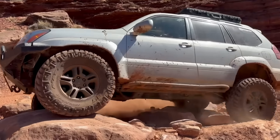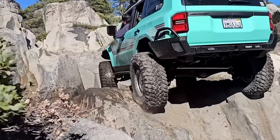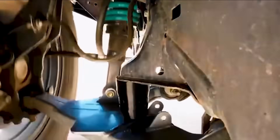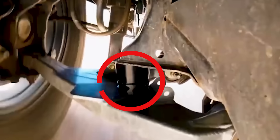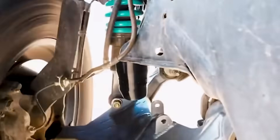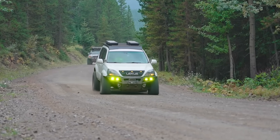What the heck is a bump stop? If you are an off-roader, you are driving your vehicle through very harsh terrain where the suspension is pushed right to its limit. When the suspension is fully compressed, it hits the end — the spring is fully compressed and now you're basically metal against metal. The bump stop is the last little bit of range. It is a small rubber cap, effectively, that is able to be squashed just a little bit more to make sure you don't have metal on metal, so you're not beating up your vehicle. You actually have a small final spring and stop so that everything can come to a stop before the whole vehicle bumps around. It really smooths up the ride and makes sure that you reduce the damage on your vehicle.